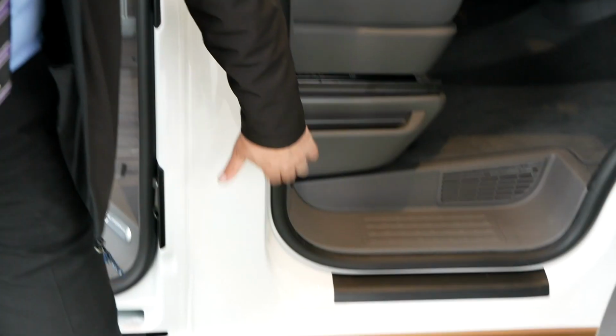So the auxiliary heating system is designed to work completely independently from the vehicle itself. This is for when you're camping, parked up on the side of a road or camping overnight, and you want your heating system on. Essentially it's a separate heater, located underneath the body of the vehicle, about in the middle. It has its own exhaust system, which comes out along the line of your main exhaust, pointing towards it.